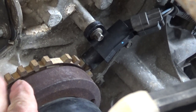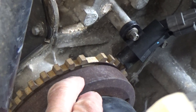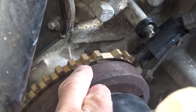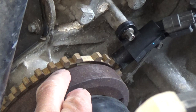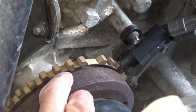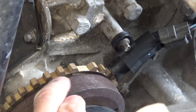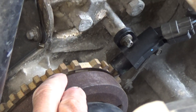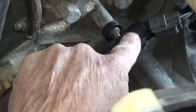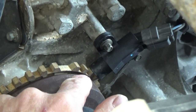I've seen this on other Fords for a lot of years now. I just haven't had to do this before. Did it one time on a Pontiac I used to have — I changed a coil pack on that to fix one problem, and then one time it quit running at work. I had to put it on a trailer, bring it home, and the next day I went back with a pickup truck and trailer and loaded the car up. I ended up changing the crank sensor, which was on the side of the motor in that case and actually went inside through a hole.